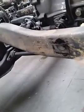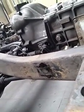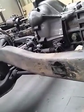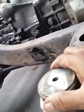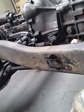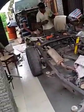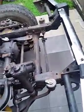Don't just do a bracket or a cup in the local grinding, whatever you call it in the workshop. It's better to get an old Pajero bracket, redo it in this pattern, use it and do the welding, rather than making a bracket on a lathe machine. The lathe machine part will be mild steel, but this is not just mild steel, this is high carbon steel which has extra strength. So that's very important. These are the front mountings which have to match exactly to the one he is doing in that nose cut. Again I show you this one.